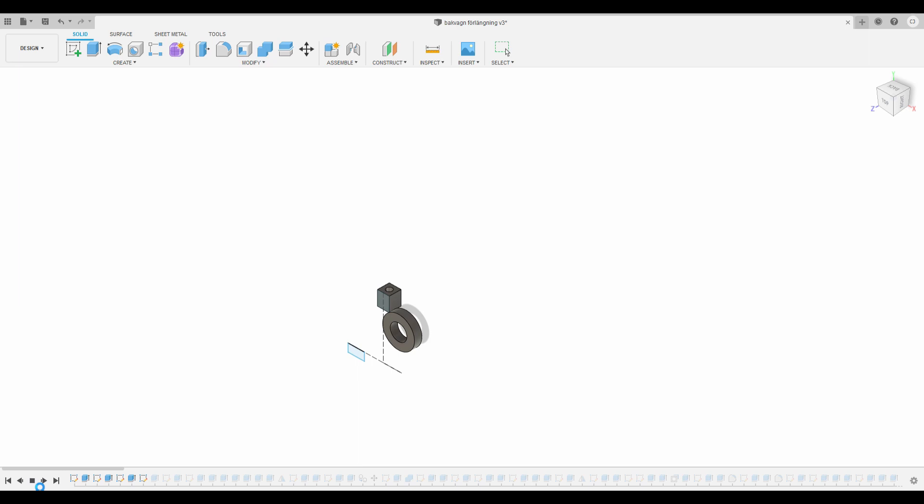So now I'm going to run you through the whole process in Fusion — how I drew it and built it. If you are not interested in that kind of stuff and just want to see me mount it and the results, you can skip forward. This piece I did not intend to use. I just wanted to make sure that I got the holes right when I put the screws, so I measured out the distances and drew it up so I could print something out and verify it on the car. It's a good way to not waste plastic on making a whole piece and then have to change it. And of course I nailed it on the first try.